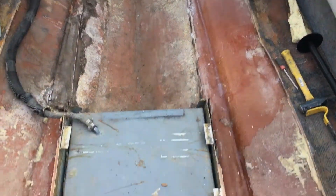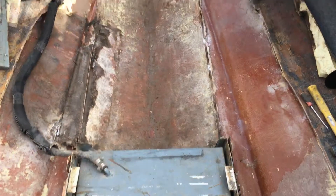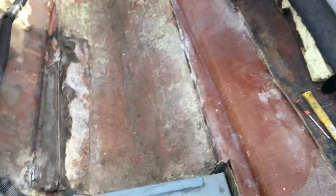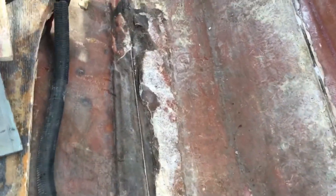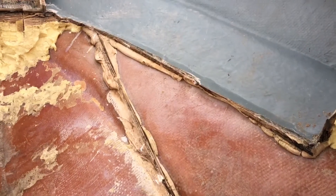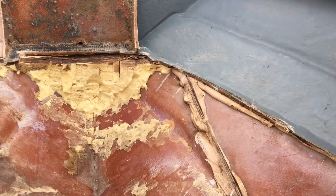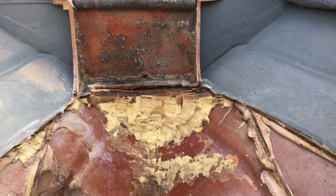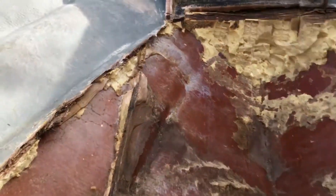Just a quick update here on Super Bowl weekend. Got most of the stringers out back to the fuel tank, the two bow boxes up front, the seats, and the storage. Still need to work on that front section to get more of the decking out. You can see where the stringers ended up here at the front of the hull.